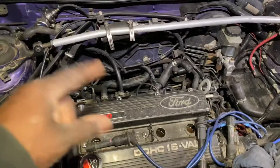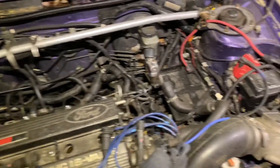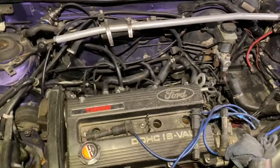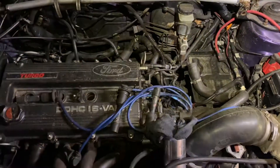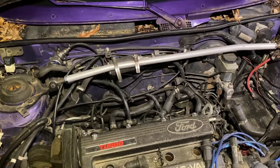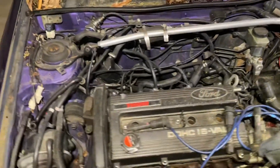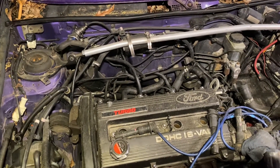I've already started back there. I actually took that intake off to use it on my wife's car so she could have her normal four-wire TPS for her automatic. Because of one intake I actually got from Larry Dixon — that's his Larry Dixon intake — I couldn't use that one because it was only a three-wire TPS for automatic, so it didn't work out. I ended up having to just use a normal intake so she could put the four-wire TPS throttle body on it. The one I got from Larry Dixon had a 5.0 throttle body flange cut and welded to it, so we couldn't use that. I might use that on this one — we'll see.